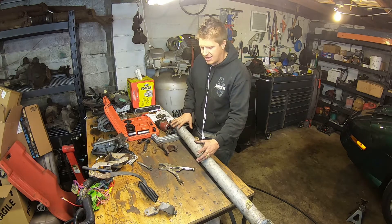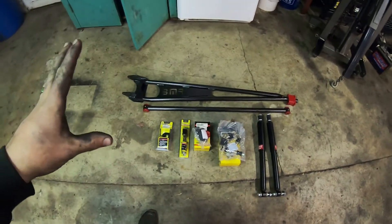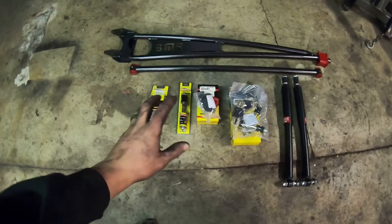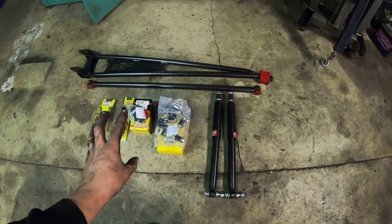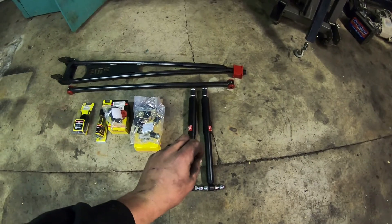We're going to sit this to the side for the time being and work on a bunch of the other parts that we have to get put onto this thing. So these are all really nice parts, high quality stuff. We have a new torque arm — Glenn got this from BMR — same with the new track bar, and they both have urethane bushings. Glenn also got complete urethane bushing sets for the front and rear sway bars, and new XLG shock absorbers for the rear. The urethane bushings are going to help improve his handling, and the new shocks are going to tighten things up a little bit in the rear with a stiffer compression rate than the factory ones. Pretty much all of this stuff is remove and replace — nothing complicated, nothing elaborate. Take the old part out, install the new part. So let's get under there and do it.